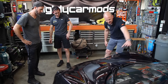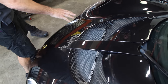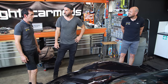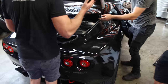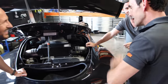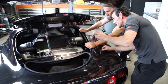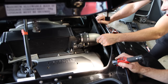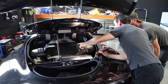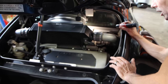You can put big power in them and you don't get cooling problems. That's a nice little modification to have at the moment. These make 240 horsepower, but you've had them up to 500-something, haven't you? Oh, you can, yeah. I love the simplicity - the clip going over that holds the boot. It's all about simplicity and adding lightness. The engine looks pretty standard - standard headers, standard intercooler. You can get a bigger intercooler and a bigger supercharger. It's already pretty fat but you can get a lot fatter - a lot bigger core.